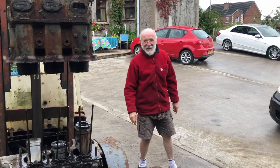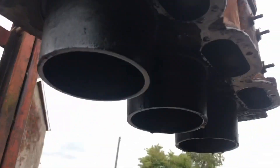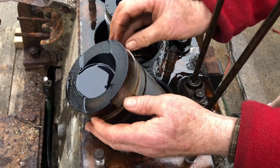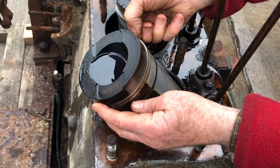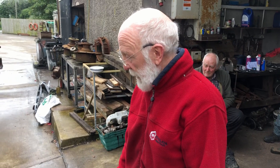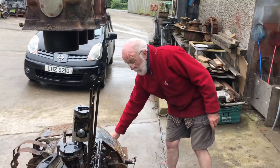Unbelievable! Isn't that amazing? And this engine probably hasn't run for 30 years or something — no bent push rods, beautiful pistons. The rings are actually still moving. I had this soaked in diesel and that helped the whole process. The rings are still free, there's not even that much wear. The gap between the ring and the piston is how we tell the wear. The oil ring is going to need some attention, but we'll fit new pistons anyway. The conrods are free, the whole lot's free.